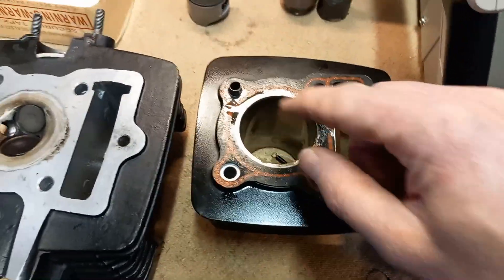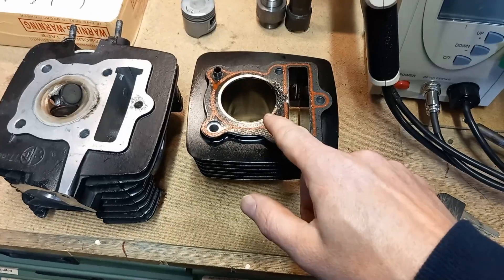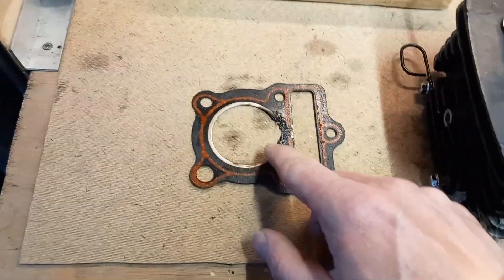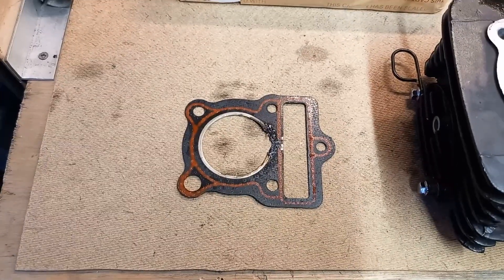That has damaged the head gasket. It's probably the alignment of those holes in the gasket that caused my problem. If any of you wants to do this job, please check this first. I posted this on a Mash owner's Facebook group and another guy showed me a picture who had the exact same head gasket failure, only a little bit lower — so it's pretty obvious that the alignment and production precision of these head gaskets is out of order. Any of you doing this overhaul, please check the quality of your gaskets before you install them. I never made a point of this in the hundreds of engines I've rebuilt — people just put a head gasket on and assume it'll work, but apparently there is a quality problem.